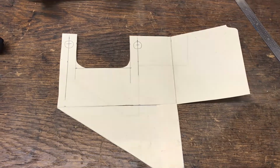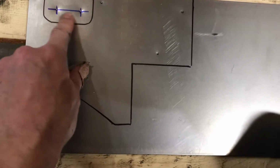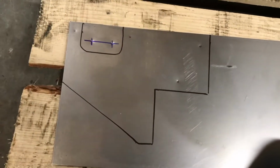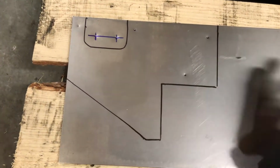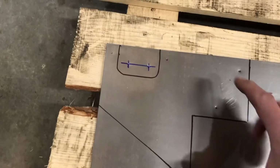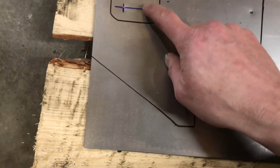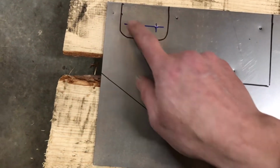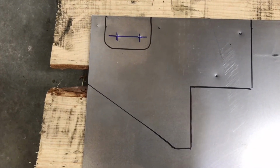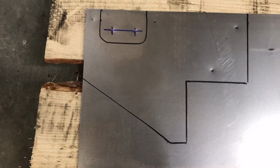Or something like that. Alright, what I like to do is lay it out on a piece of steel. Go ahead and center punch all the holes that you're going to need first. Drill those, because it's a lot easier to hang on to the part when it's a big piece of steel versus a smaller bracket that you're cutting out. So I drill first. I'm going to put these radiuses. I got a hole cutter, so I centered those to make the radiuses. It's always good to have inside radiuses. It is better for strength, but for this it wouldn't matter, but it just looks a whole lot better instead of a sharp corner.